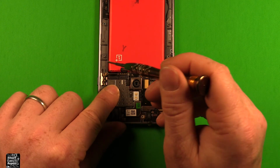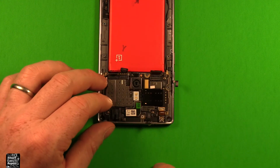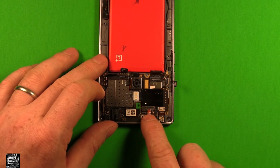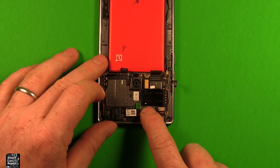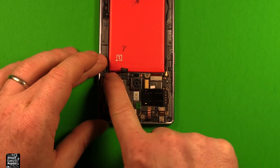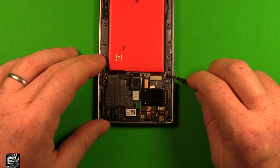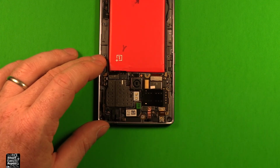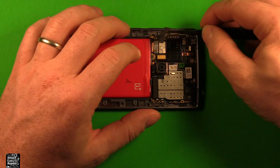Then you want to grab your screw and put it in here. Then we'll start reconnecting things. So let's go ahead and start reconnecting some things. So let's reconnect this. Push the copper tape back down. Let's reconnect this connector. Reconnect this connector. Reconnect these two, and also let's reconnect this antenna wire right here. Make sure it's pushed down in its channel, the wire, when you're done. Let's grab our tape and put it back on here.